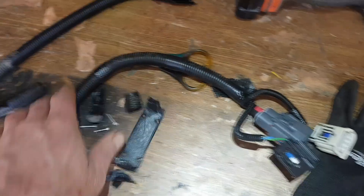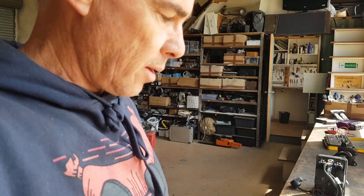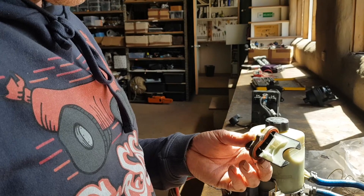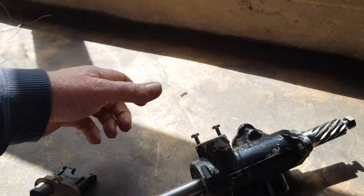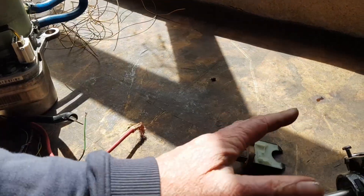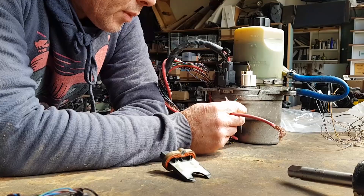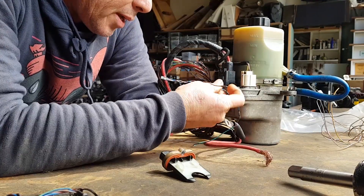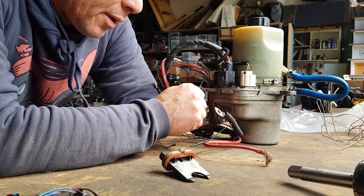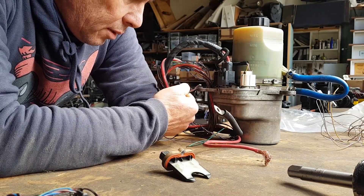Just re-wrapping the harness for the power steering pump. After a bit of testing and experimentation, it didn't matter what I did to the CAN bus frames — modifying them or whatever — it just ran at full speed the whole time. Then I realized this steering column sensor is what controls the pump speed. I pulled this out of one of the other Focuses going to the metal recycler. The pump will speed up and slow down depending on how you're turning the steering column. All you have to do is send the CAN bus message — you only have to send it once — then it spins up and you've got power steering.